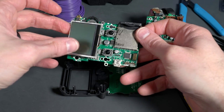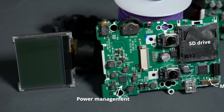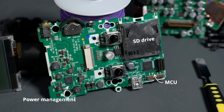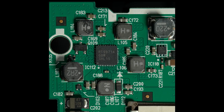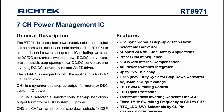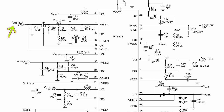Looking at the other side of this board, we see that's where the actual SD card connector is, and it's also where the LCD attaches to the unit. And of course that's expected because you can also see the microcontroller down in the corner — that's the thing that's actually going to manage sending all the different signals to the places they need to be sent. In close up, this side of the board features a few different voltage regulation devices. We can see the RichTech RT9971, which is actually a seven-channel power management IC. This thing is going to output most of the voltages needed to operate the various stuff on this board. From the data sheet, it's pretty much made for two-AA-battery applications — it outputs something like a 3.3 volt channel, a 5 volt channel, a 15 volt channel, a negative 7 volt channel, as well as a handful of other accessory rails for things like LEDs or whatever else you might have hooked up.